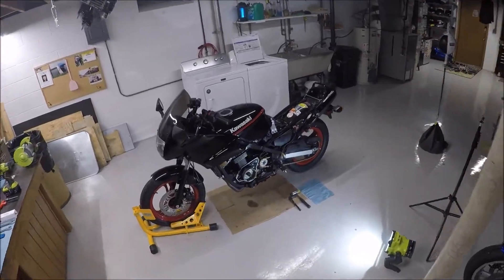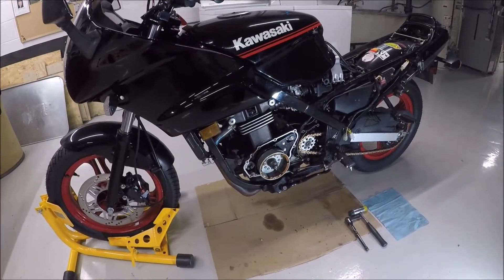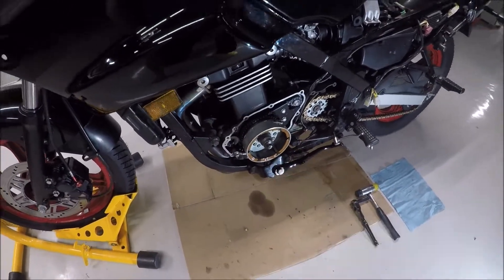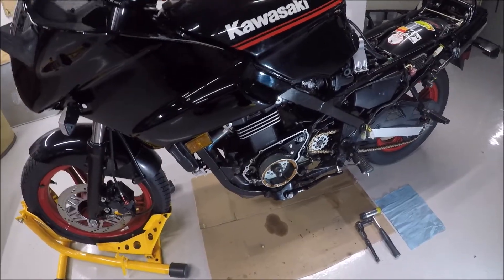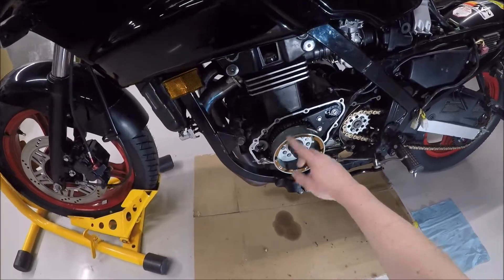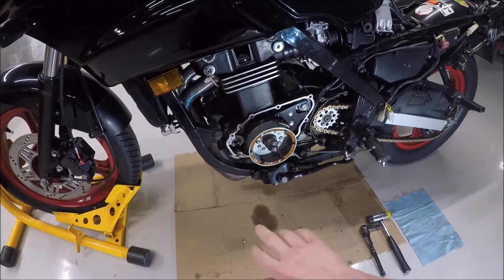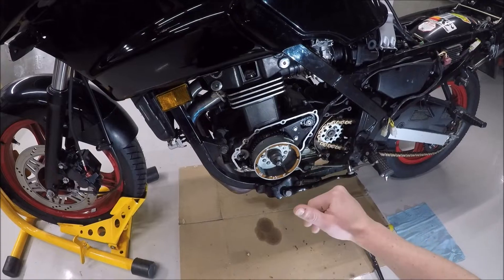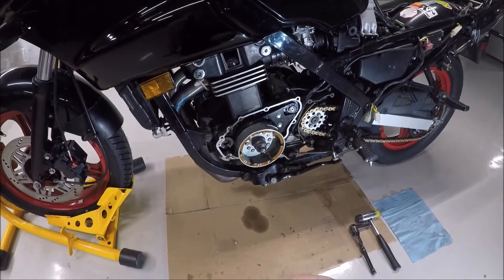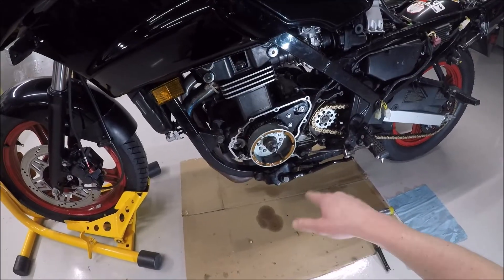I'm doing my last bit of maintenance on this 1990 Kawasaki EX500. It wasn't part of my original plans, but after reading a lot about it I've decided to upgrade — swapping the OEM flywheel with an RM stator flywheel replacement. Everything I'm reading says this thing is a ticking time bomb: the epoxy used to adhere the magnets to the flywheel can let go, and then you've got magnets kicking around with catastrophic results. This was an issue that plagued these first-generation bikes, but not the later generations since they did them differently.